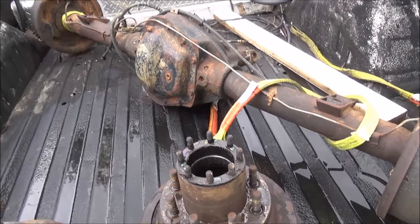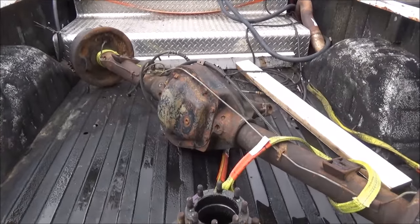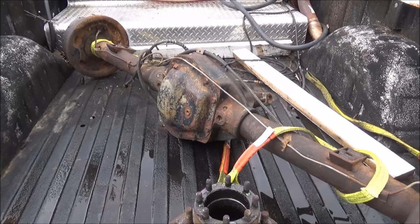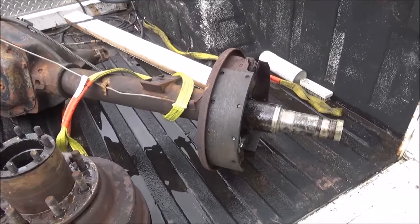So what I'm doing is I'm swapping this axle underneath of my crew cab, because that axle has 307 gears and the original gas axle in this truck's 456s. So it's flat on the floor, governed in order to run 70 miles an hour, which isn't terribly efficient or really nice on the engine.